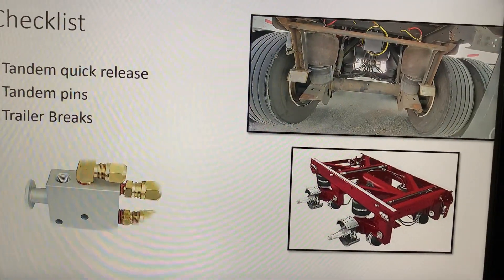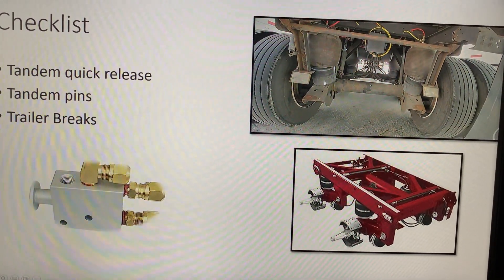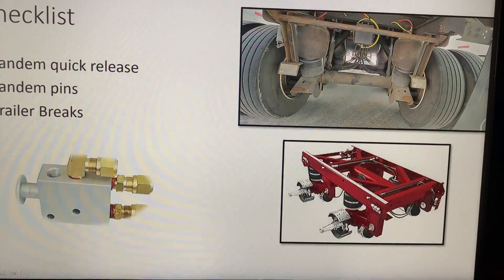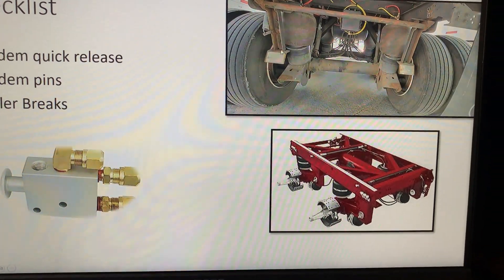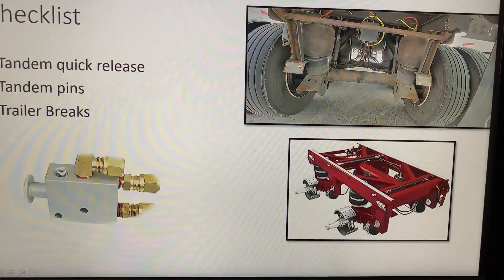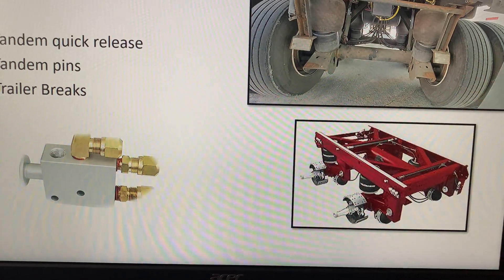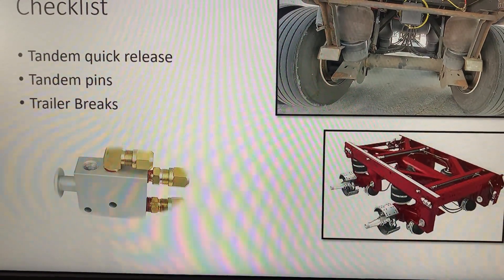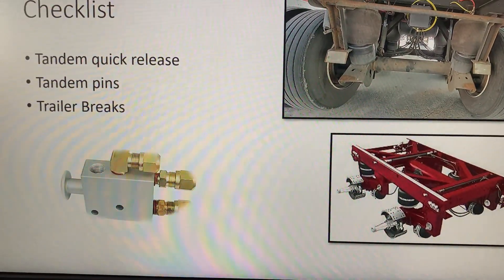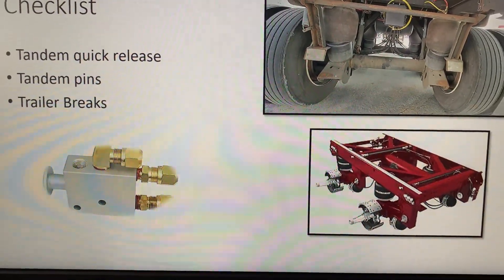You want to look at your airbags. If they're inflated all the way, that means your valve — one of the valves — is not dumping the air. If the pins go in, that means this one is working fine. I think they call it a shore lock — these legs are basically designed to hold the weight of the trailer when the airbag deflates. Usually when you pull the pin, the valve in there will release the air out of the airbags, and these legs will touch here.